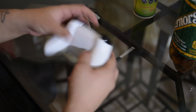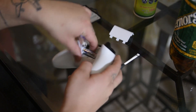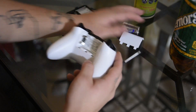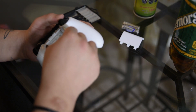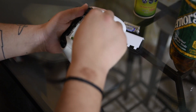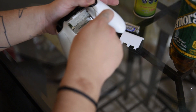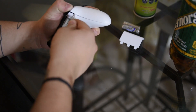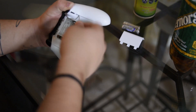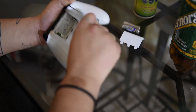You're going to start by flipping the controller over, taking the back off. We're going to take these guys off right here — the battery's out. And then you're just going to kind of go up and down this crease right here with your mini screwdriver. It helps if you push this button in. I'm not sure if it actually does anything but it helps me when I tear this apart. So we've got this first piece pried apart, just kind of work your way down shoving the flathead screwdriver in there.